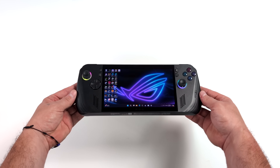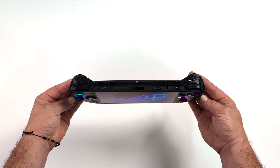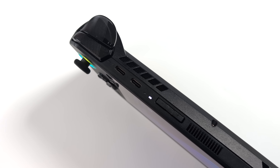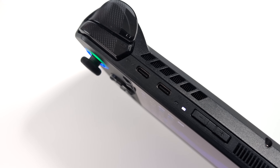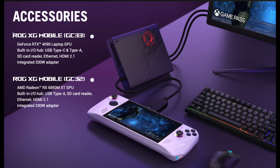I completely understand that first and foremost this is a handheld gaming PC, but with the addition of USB 4 on the X, it's easier than ever to really up the GPU performance by using an external GPU. It's got USB 4 and USB 3.2. On the original ROG Ally, we could always connect an eGPU, but it was kind of specific — the original didn't have USB 4 or Thunderbolt. It had what was known as the XG Mobile port, and it did work out really well with the correct GPU, but we were very limited and the price on those can definitely get up there. The bandwidth of the XG port is definitely more than USB 4, but I still think we can see some really great performance over USB 4 running at a 40 gig protocol.